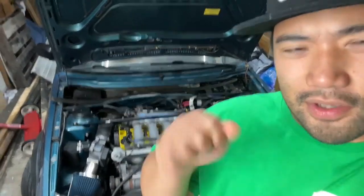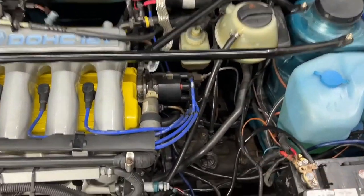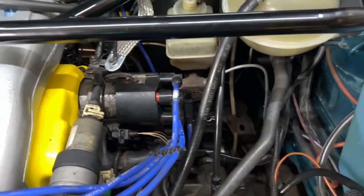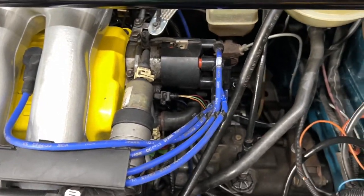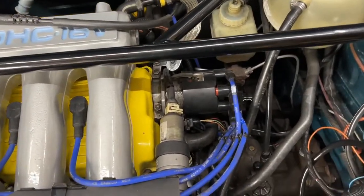Basically what would happen is, we turn the ignition, crank, but no start. And obviously we tested the coil, and something funky was happening with the distributor, where the cap was missing this little lead thing at the tip of it. We tried replacing that thinking it would work, but still no go. Until watching Thomas's video, we tried to run a little test and it goes as follows.